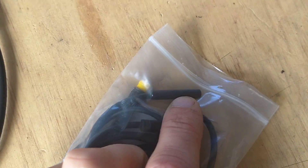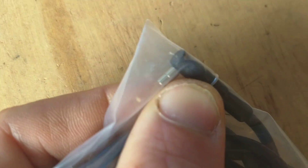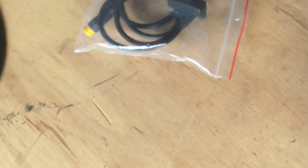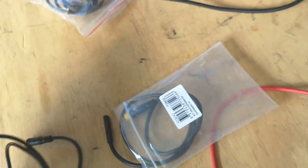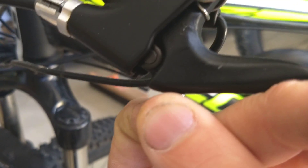This thing here is called a hall sensor, and a hall sensor measures magnetic field — it knows when a magnet is nearby. Along with your hall sensor you have a tiny little magnet or two. You stick the hall sensor onto the brake body and you put the magnet onto the lever, such that when you pull the brake you get a gap opening up between them.